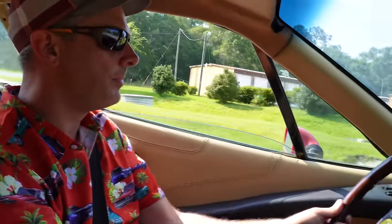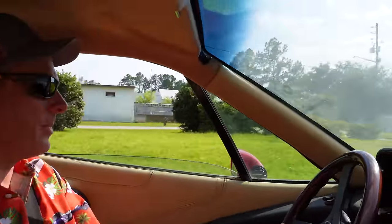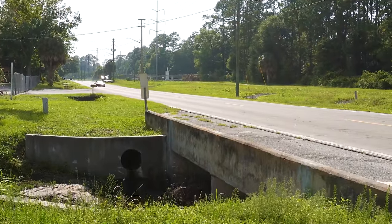So it's got such a fine window of the map sensor. Cruising is, say, in the mid to upper 80s in kPa, but then wide open is like 96 to 98 kPa. With most cars, cruising is typically in the 50s for kPa. So you've got a big, huge window of tuning. Basically what it's trying to do is when we're light accelerating, you hear that little blah, blah, blah right there. So it's trying to overlap the parts of the map where we're wide open versus where it is when it's cruising.